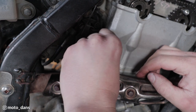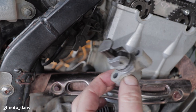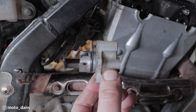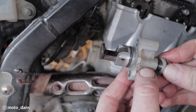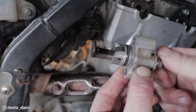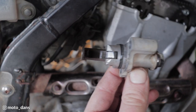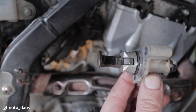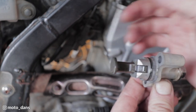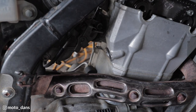Let's see how much is left on that tensioner. What we want to do is put the spring back in and see how much it moves. About 6 clicks - you can kind of see where it was and how much it's come out. This is probably actually getting near the end of its life - that would be the cam chain. But there is still room there. Now we can remove the camshafts.